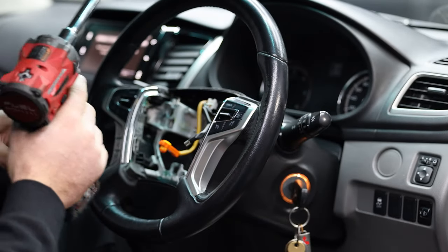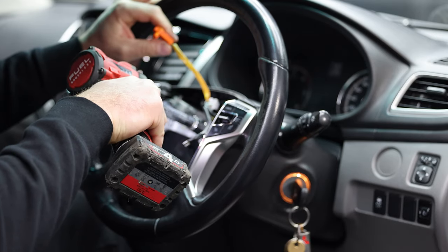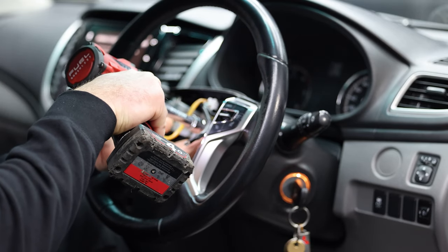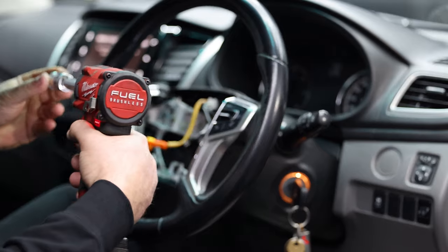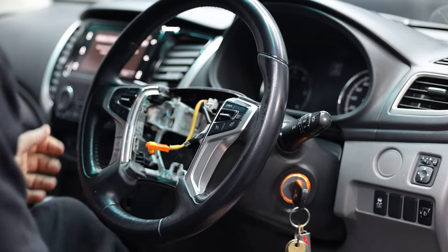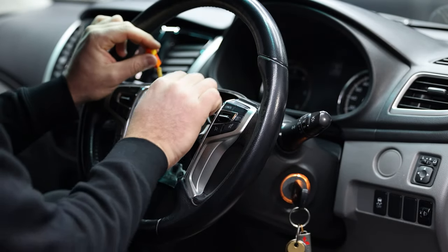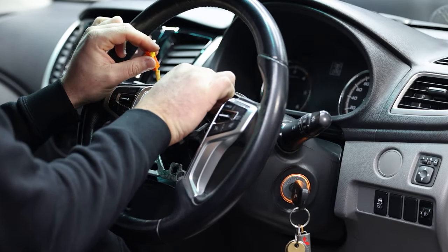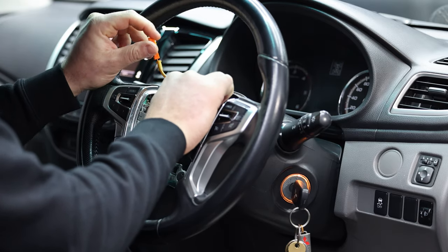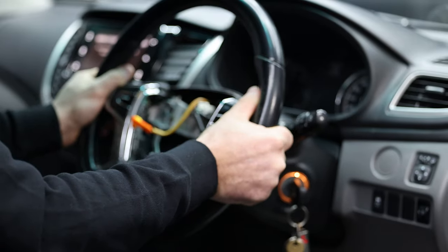You've got the horn cable itself — just put that safely on the passenger seat. Then grab a 17 mil socket. It's very quick and easy to do something like this; anybody can do it, you just need some tools and a bit of time. Once you've done that, bolt out, then unplug the steering controls.